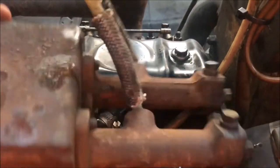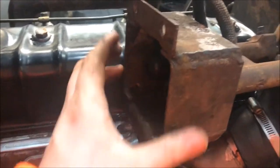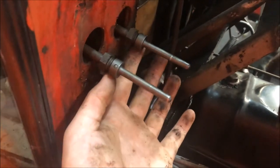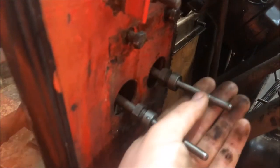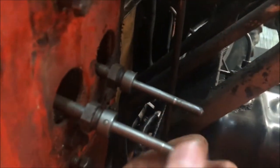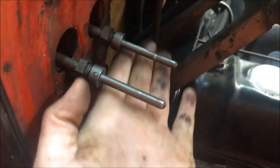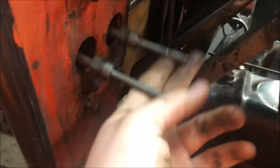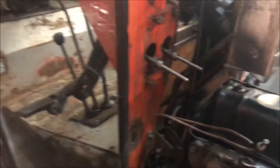The only way to find out is to completely split them all out. I've taken the four bolts off the housing — you can see it's a steel housing — and you just pull them straight out, leaving the push rods on the back of the brake pedals, which you can see through the cab. There's a little bit of wear, just a slight marking there, more on this side than the other, but overall in pretty good shape. There's not too much play, and the pedals are all free — they didn't jam down or anything — so it's purely a hydraulic fault at the moment.